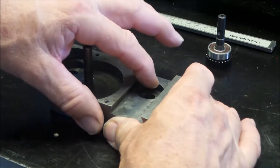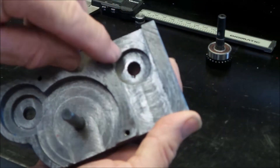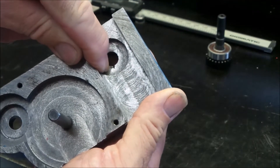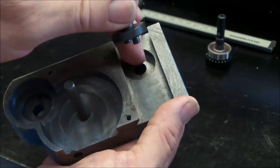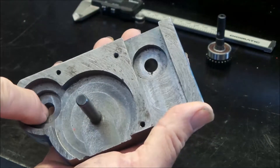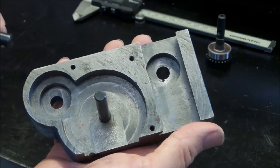While I'm at it, there's a bit of a burr in the bottom of this hole here, right around this edge. That's where this component goes in — it'll be rubbing on the centre. So I might just put a slight chamfer on the inside of that hole, same as this one here, to make sure this bearing is going to sit down properly.